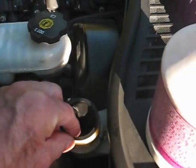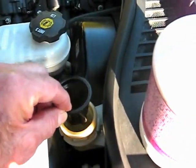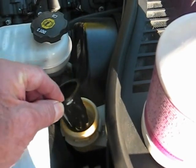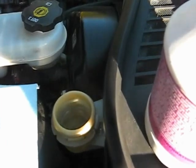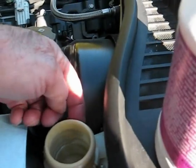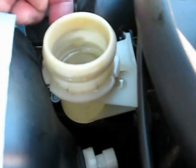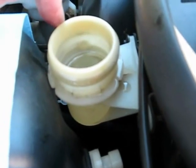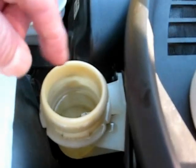There's the cap, and a little rubber bladder in here. This minimizes how much air is in the clutch master cylinder. And you can see the fill line — there's a little dent in the inside circumference of the clutch master cylinder, and that's what you fill it to.